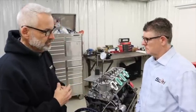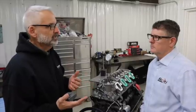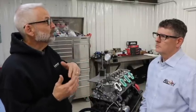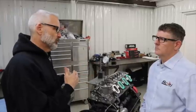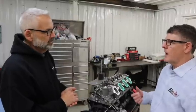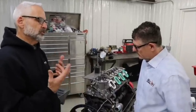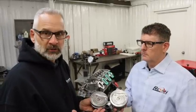There is a point where you would run no VCT on a drag engine. With the stage one heads and the stage 1B cam with the stock intake, we made 600 horsepower and 600 foot-pounds of torque. From full advance to full retard there's 35 foot-pounds difference at low speed and 30 horsepower peak. For a drag application you'd run it fully retarded and never miss that low-speed torque. But for a truck on the street lugging at lower speeds, that 35 foot-pounds does a lot of good. The caveat is that torque comes with knock tendency, so you really need to run high octane fuel to avoid detonation.